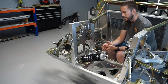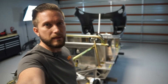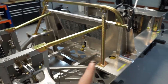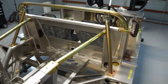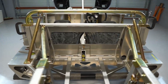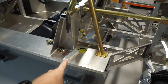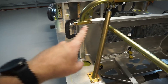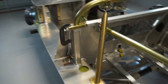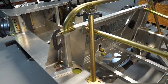Now that that's resolved, I'll move on to a general update on where I'm at with the build. Next I'm going to tackle the roll bar — it's been mocked up and clamped on for quite some time in recent episodes and I just haven't got around to finalizing that install. I need to insert some aluminium blocks into the top tube and drill and tap a number of screws to hold the roll bar onto the chassis. The stays are fitted off but I need to finish them and add a lock nut to the rod end.